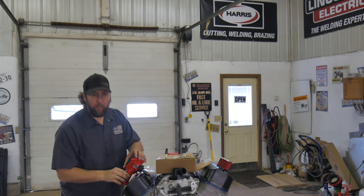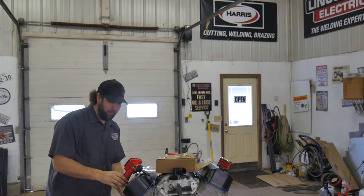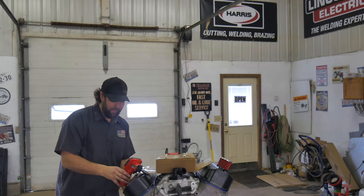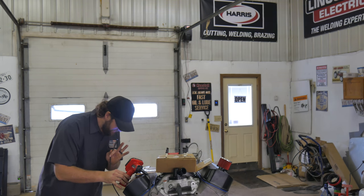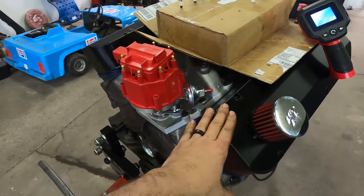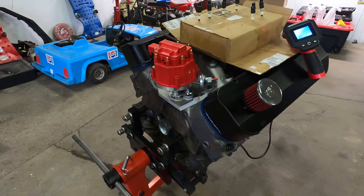Got my cheap little Harbor Freight camera jammed in here. I already went all the way around and looked at the cylinder walls - looking for that nice crosshatch still, making sure nothing got washed down, and also any damage, heavy vertical scars. Everything looks really good. We've still got the really nice crosshatch in there, no scrapes or scratches vertically in the cylinder bores. So overall, bill of health - she's looking good. Let's get the valve covers off, get the impact out, and go ahead and take the intake off too, glance over the valve train.